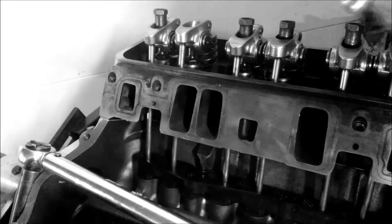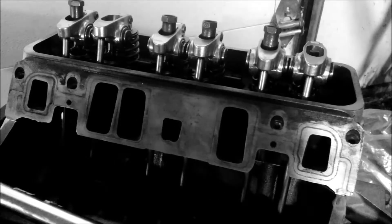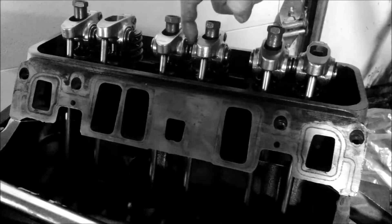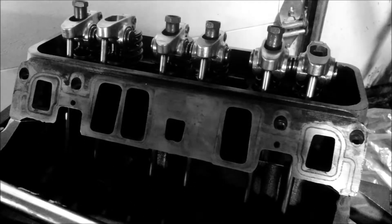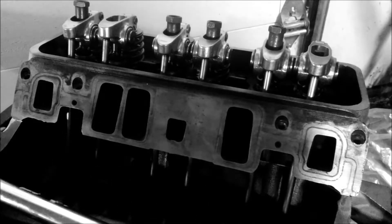You don't have to use a ton of force — you don't want to break them and stretch them. So that's it. Hopefully that gives you a little guidance on how to set valves. This is a 4.3. I've been doing a couple videos on how to do an adjustable valve train and how to set these up. It's all in forums — there's no books, so I had to research it, and most shops don't even know what you can or can't do. These are not narrow rocker arms, which is why they're so close, and you have to use a steel valve cover to try to make it work. These are shimmed a little bit, so you can watch my other videos about that. Hopefully it gives you a little guidance — thank you for watching.